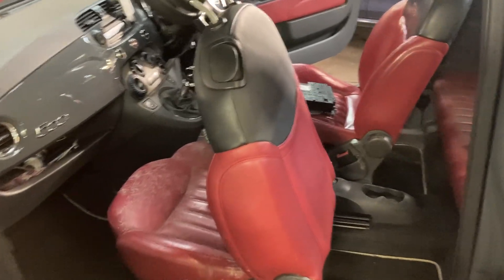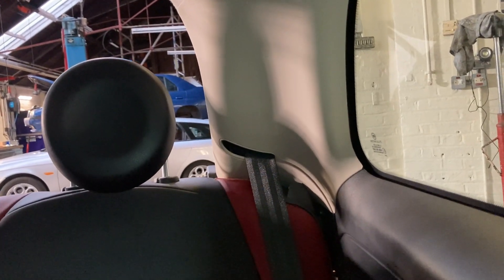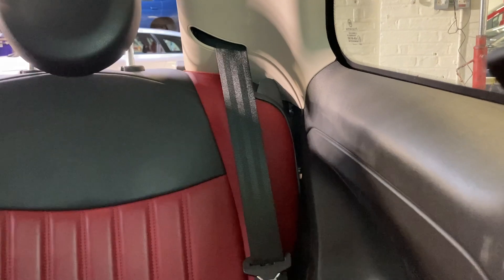We want to attack the Blue and Me unit. It's not a job for the faint of heart though — this is where it lives. If you have a Fiat 500 and look around, you can probably tell within about 30 seconds that this is not a panel that comes out so easily. There are loads of different bolts everywhere, the seatbelt mounts through there, bolts down here. There's also stuff under the bench, so this is a bench-out job. Trim's popped, and it does require a lot of cleaning afterwards, but it is a job we can do.